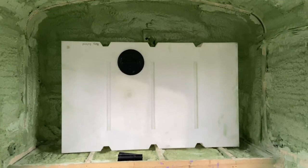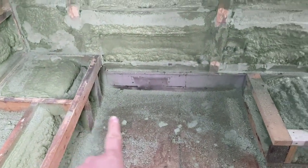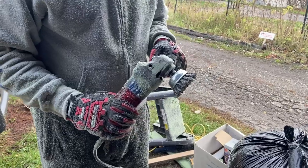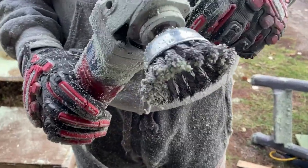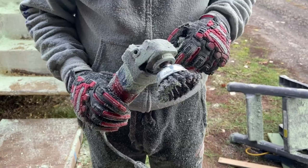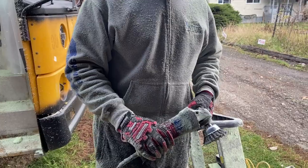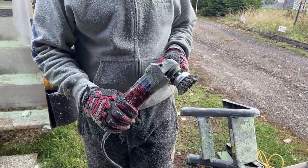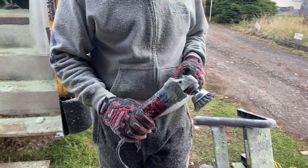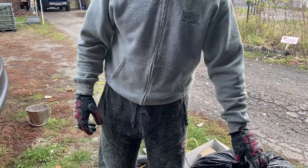This is our freshwater tank that's going to be right here under the bed. The measurements are perfect to fit between here and here. So this is what we used mostly to cut back the spray foam in the bus, is this grinder with a metal wire wheel. It worked the best. Rory tried a few different things like a Sawzall blade and some other things, and we found that this worked the best. If you do have any other suggestions on how to cut back spray foam easier, you can comment below. But we found that worked. Either way, it's a tedious job and it just takes time.